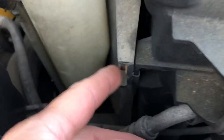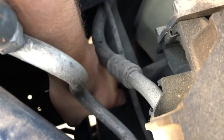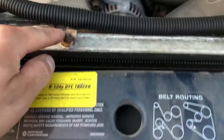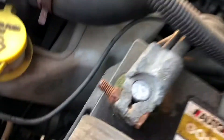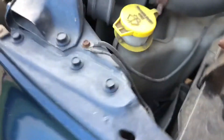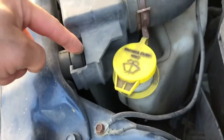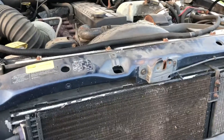First we've got to undo the bolt there, and there's one down below. So you've got one there, one there — take them off. You're also going to have the lower radiator clip down here for the lower hose that we'll need to pop off. We'll also take these off up here and pull the coolant reservoir and washer fluid reservoir out of the way to reach the bolts below. Then take the two bolts off up here — one there and one there — and you should be able to pull the radiator out. Let me find the drain.